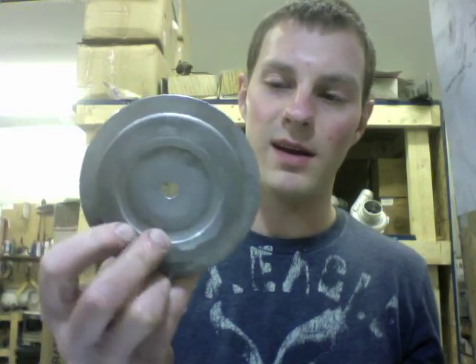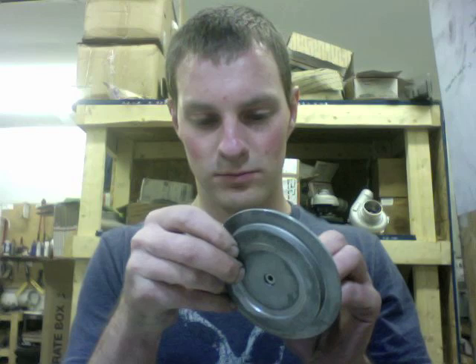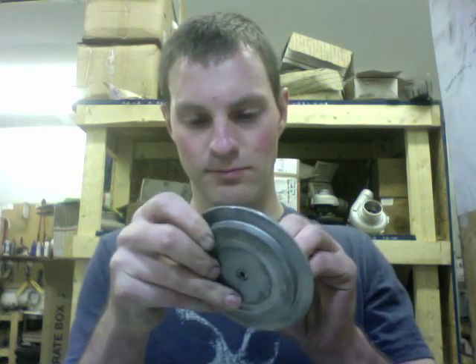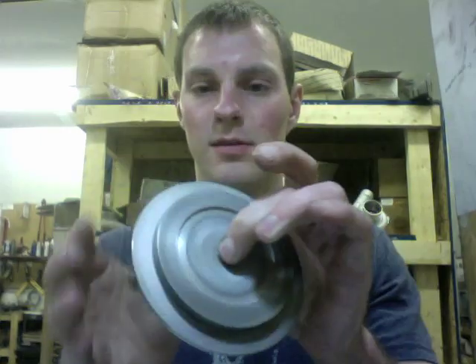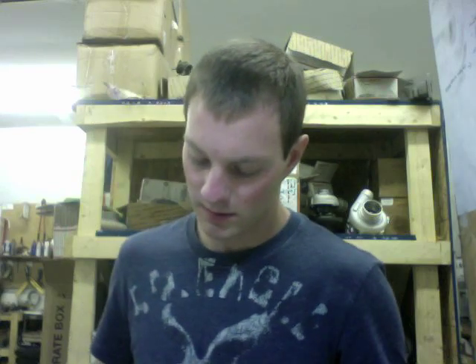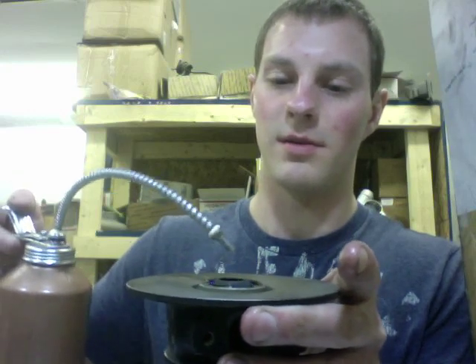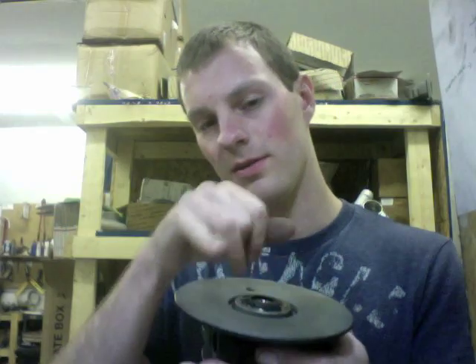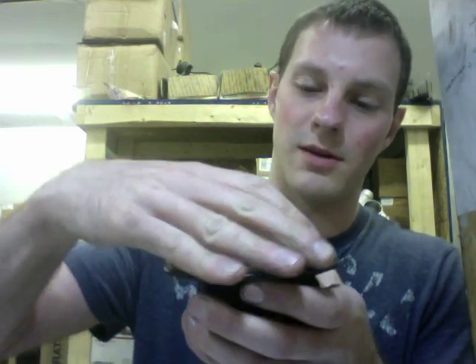For this plate, I had to machine this for our larger compressor wheel. You just wiggle that in until it goes in. Now you can take the plate and install it on top of the bearing housing. But first, you want to go ahead and squirt some oil onto the top of the bearing, and also be sure to oil inside the oil feed and inside the journal bearing too. You can go ahead and lay the plate flat on the bearing housing, then put the heat shield on the back of the bearing housing.